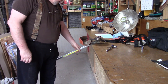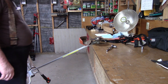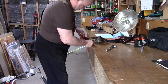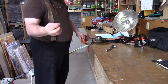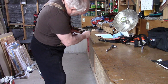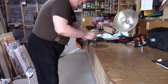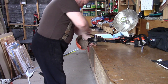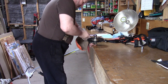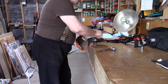Here's my whipper snipper. If anybody's worked on whipper snippers before, you know that they're like an octopus — they're gangly and they're hard to get someplace where you can get a hold of them decent. Anyway, I have to take this wheel off, this cutter disc. There's probably a tool that came with it, but I can't find it, so I just have a nail here with the head cut off it. There's a slot on the side where you can stick that in to hold it — that locks the wheel. And this is a left-handed bolt on this, so after you make your first attempt to try to loosen it and find out just exactly how tight it is, then you can flick the ratchet over and loosen it.